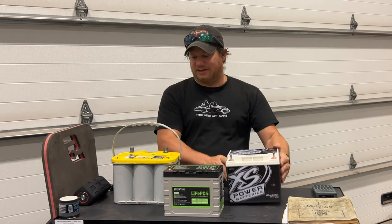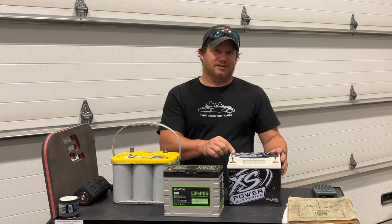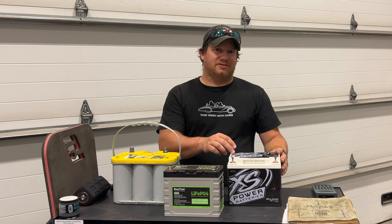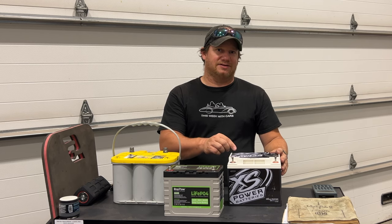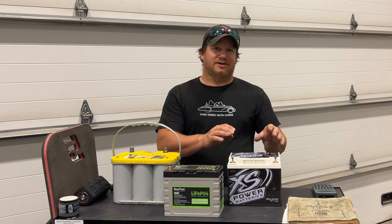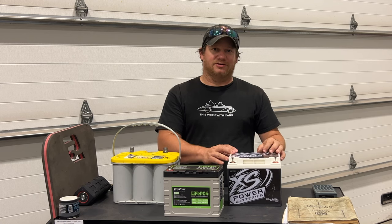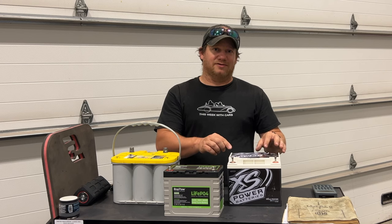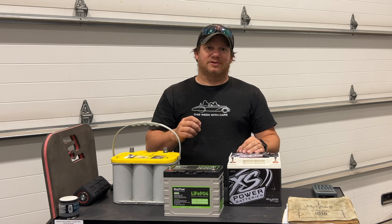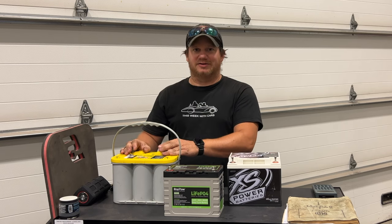So I've switched over to using ultra capacitors in a lot of my cars. This battery is very light — much lighter than the Optima. I'd say about a quarter of my cars are now converted to ultra capacitors. They're not the best for every car, especially ones with a constant drain, but for old cars with no parasitic draw I can park them all winter and the ultra cap still has plenty of power to start in spring. If you fully discharge an ultra cap, it doesn't care — just charge it back up and you're good. They also charge very quickly.